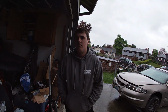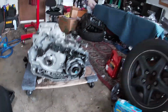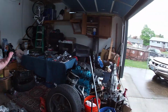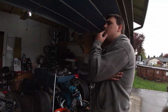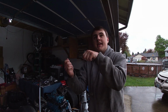Oh, shit, I forgot to tell you. I'm not sure if you'll be able to put an aftermarket cooler on, or at least use AN lines. Oh really? Why? Because I've read that the transmission cooler lines have check balls in them, so you can't remove those fittings. So you could probably buy new lines. It's $20 for all new lines, so it's not that expensive, and then cut them and route them to your transcooler. Or we can just put it back stock. So you're saying it has to have those quick disconnect fittings.